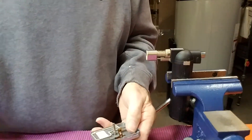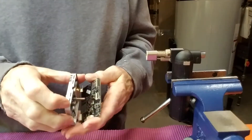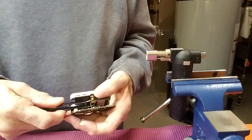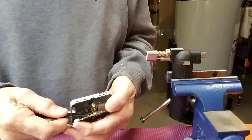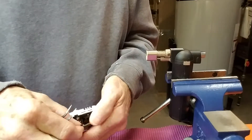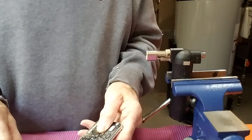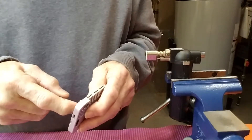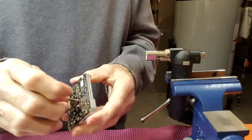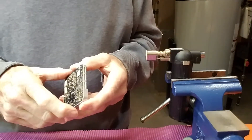The magnet is still loose on that shaft. I put this back together because you're going to be able to get to the magnet even with the cover on. You can use some tweezers, carefully put that back in, lock it down, pop it in position. Put that T6 torx screw back in and tighten it down. Now you can, with your fingernails, still get to that magnet — lift it up and move it. We put this all back together and test it to see if it centers.